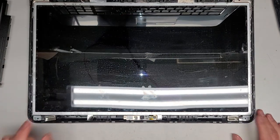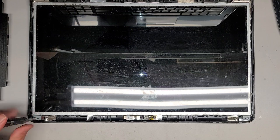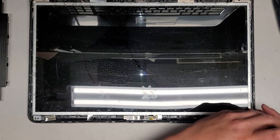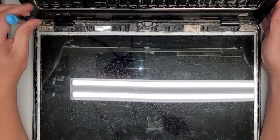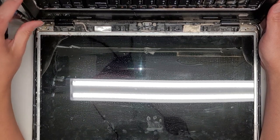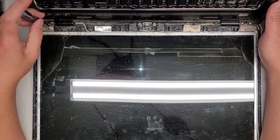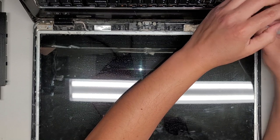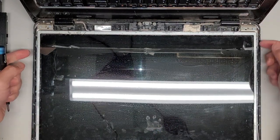We're going to take the screen out. There are two screws up in the corners. Normally I would do this while it's standing up, but I'm doing it like this to keep it in view of the camera. Keep all the screws in order because they can be different size, shape, and length. Once you get those two out, you'll also want to undo the screws down here — we're not going to completely remove them, just undo until you hear it click, then twist back two turns so you have some loose slack. We do that on both sides so we can access the screws along the side.